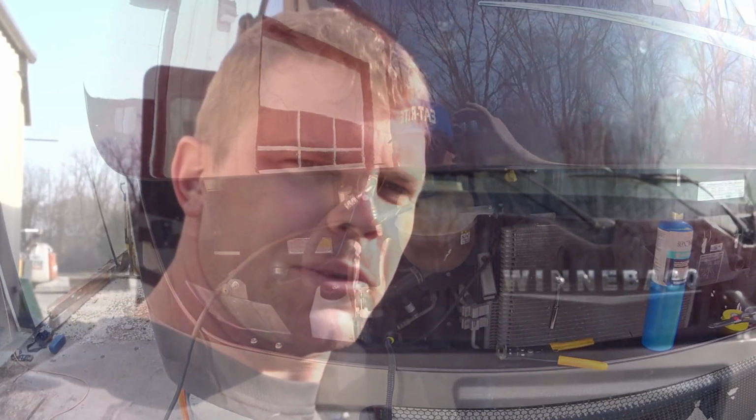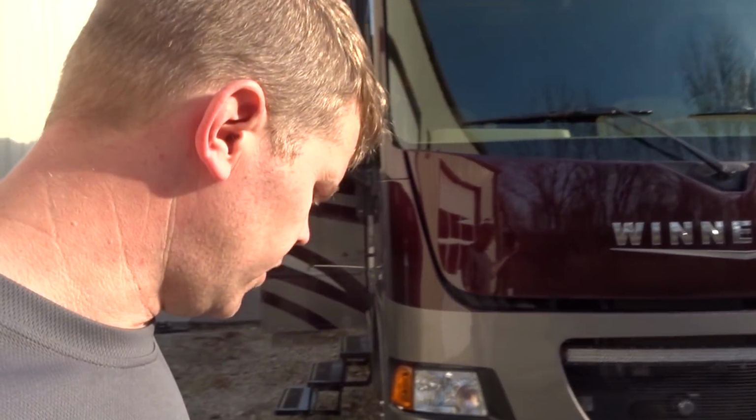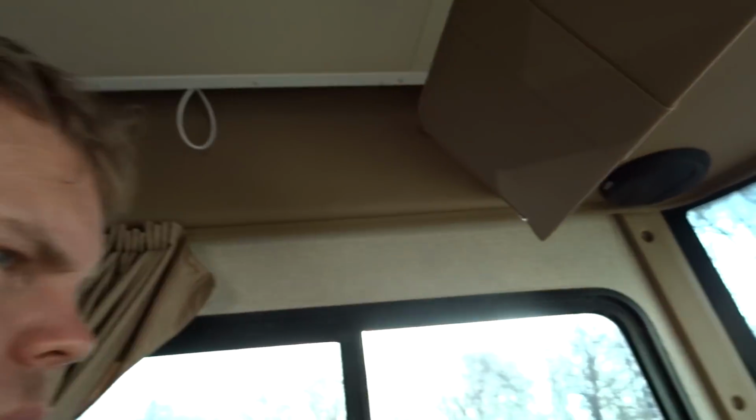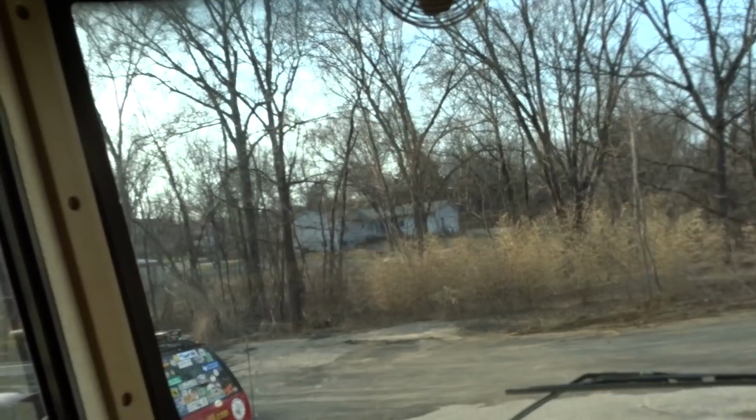Okay, I got it all wrapped up. Let's go ahead and give it a test squirt, see what happens. While I was at it, I went ahead and took an air nozzle, blew out my squirters, but probably not a good idea to do that. You probably want to take a welding tip cleaner and go to the nozzles directly and spray and grind them out that way, because I ended up blowing all the hoses off of my system.